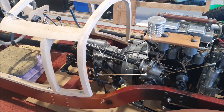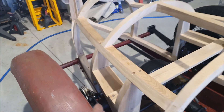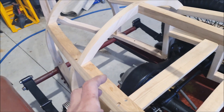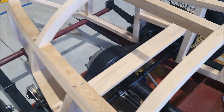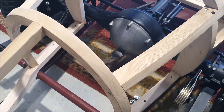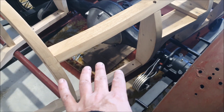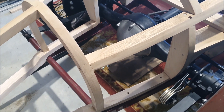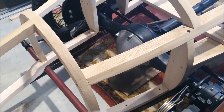The reason I need to do all of this — because it might not be obvious — is I need all of those in place before I do the skin. I'm trying to figure out everything I need to do before I can actually start the skinning on the car, because once you put the skin on the frame it's not going to come off easily. The other thing I need to look at is the petrol tank: originally I was thinking I'd reuse those mountings, but it turns out the petrol tank is actually mounted to the chassis — I think it's a three-point mount on the Brooklands.